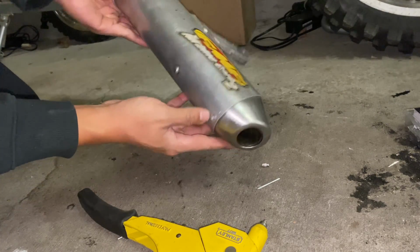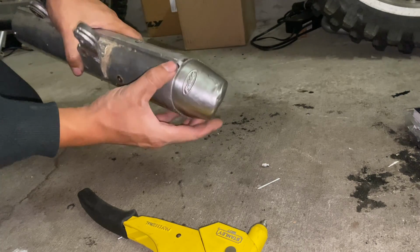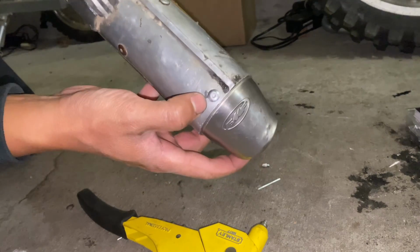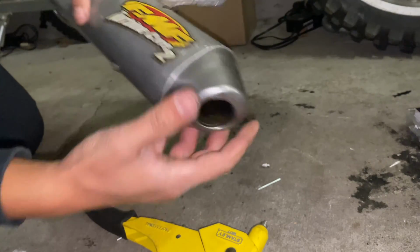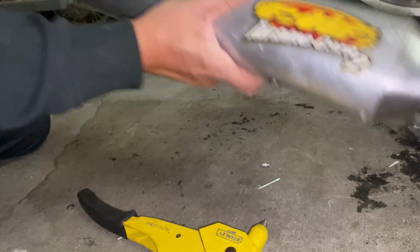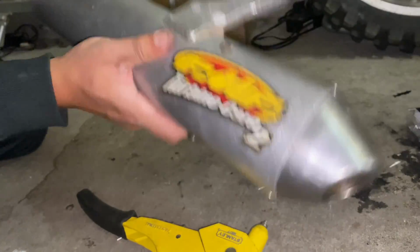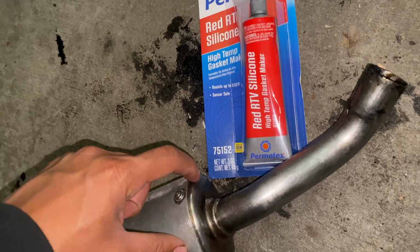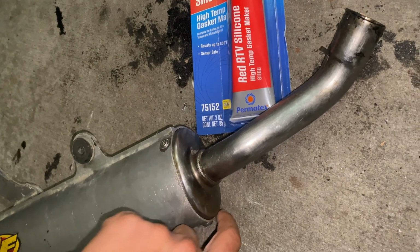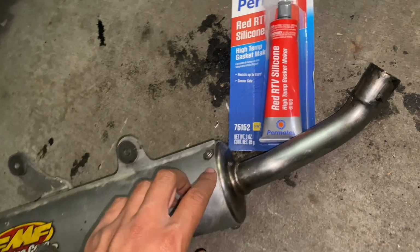There it is. The end cap is nice and secure, properly riveted from top and bottom, so the tip should not be going anywhere. No more shaking around. Now I just have to apply a thin coat of high temp silicone along the edges of the end caps to prevent any chances of exhaust leaks.